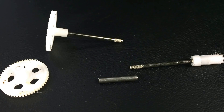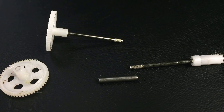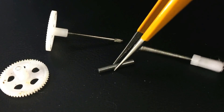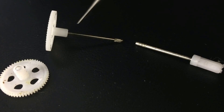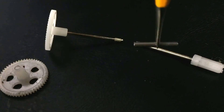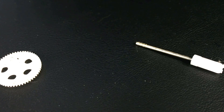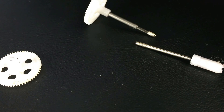I had to use quite a bit of force with that. I pulled straight out where the propeller connects to the top of the shaft, and when I pulled out, it came apart at the wheel — it separated there. I noted that there's actually an extra piece included too, and it's the center piece here — it's a slide that acts like a shaft for this metal piece to spin inside of. So when we go to put on the new part, we're going to slide that piece over the motor shaft first. If you don't do this in the right order, you're in big trouble, because it won't be able to be reassembled the right way. So you put it on like that, then put it back through the motor shaft, and then we'll put this other plastic gear piece back on.